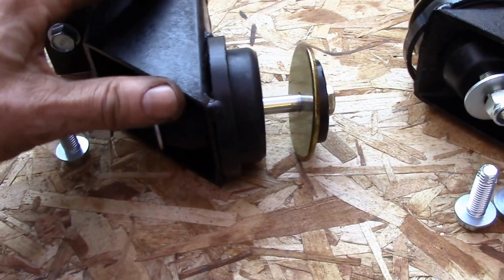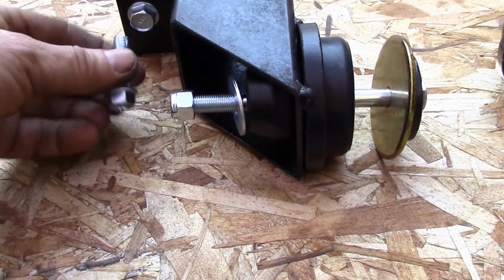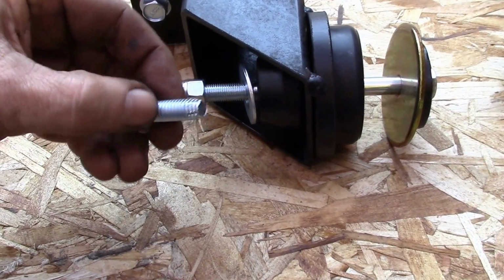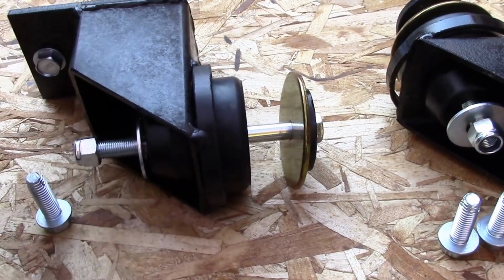and that holds this in position. Then you just mark the holes and drill them, about a 5/16 inch, 8mm hole, and then these bolts will actually cut threads into the side of the frame, and that'll hold it on in the right position. So it's actually self-locating, I should say.